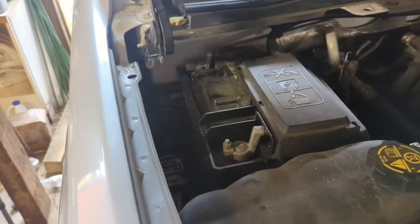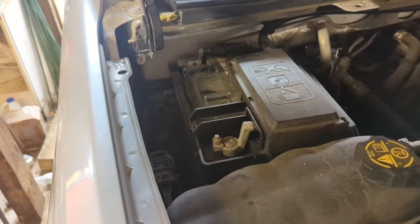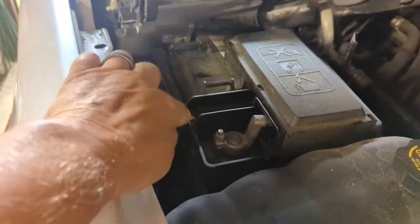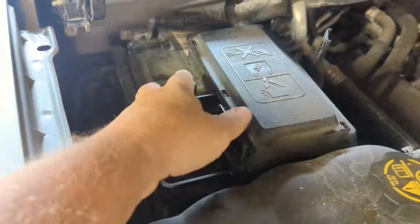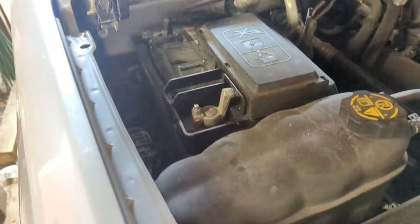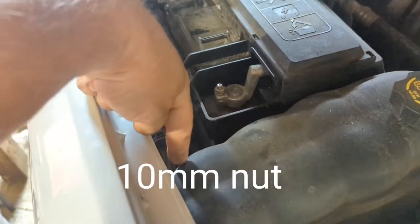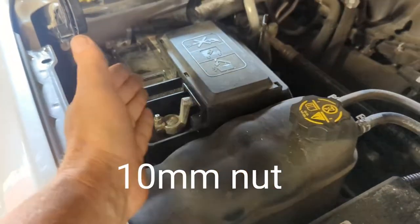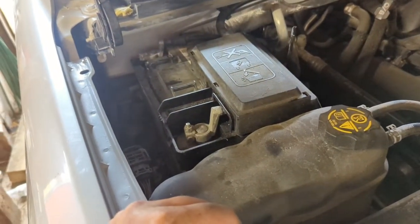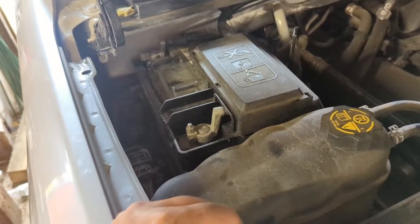Next, we're gonna deal with the terminal posts. The terminal posts are 10mm — take those off. And there's clips here that you use a flat blade screwdriver for. On the far side, all that comes off and you move it out. There's a 13mm bolt down here that holds this tank. Take it loose and you can move the overflow out. I just got finished driving this car, so I may not move that tank. It's kinda hot.